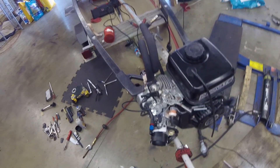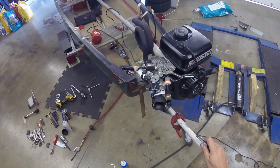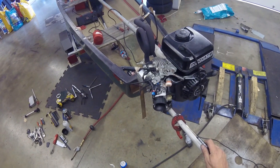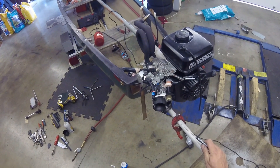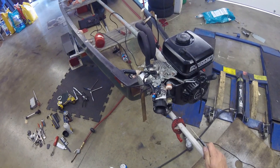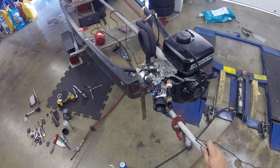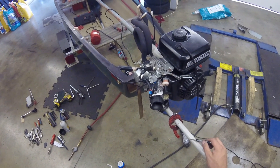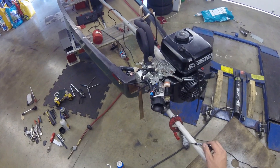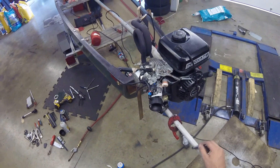This float has a metal adjustment tab like GX200 carburetors, so I'm thinking about raising the float level a bit so the valve opens further and allows more volume into the bowl. But I'm pretty sure I'll still need a better way to supply more fuel to the carb at higher RPMs.